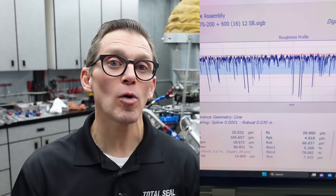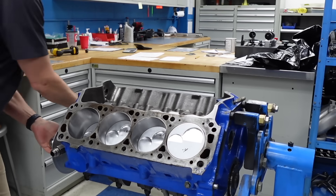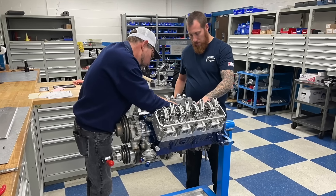We used line-to-line skirt coating on all eight pistons, new rings, new hone. The guys here at PME put the engine back together. We're now in the dyno cell at Pro Motor Engines in North Carolina. We're going to run it and see how she does with this new hone and that line-to-line skirt coating — see how it does blow-by-wise and we'll show you the results.